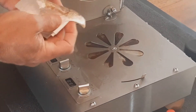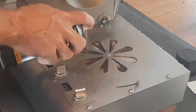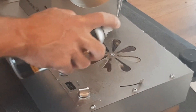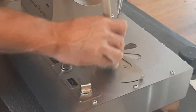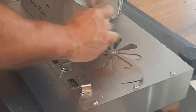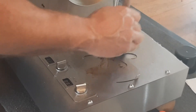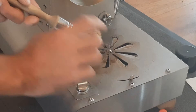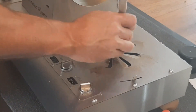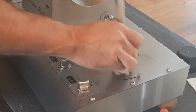This will soften up the oils. I'm just going to use this thin brush and, as you can see, the coffee oils loosen up quite nicely. Not too much pressure on the valve itself — just paint it until you can see the oil is coming off. In the areas where it's a little bit thick, just add a little bit more of the cleaner. You can also open and close the valve to get into the little corners. It's not necessary to remove all of it; it just takes it back to a much cleaner state.